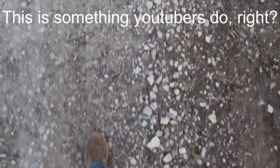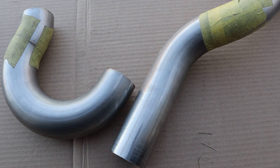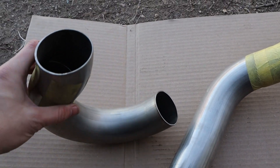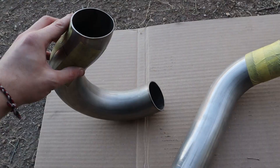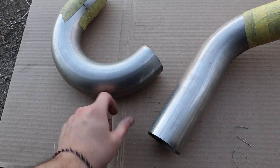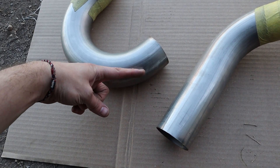I got some people to come help me turn the wheels. I basically ended up jacking the front end up and turning it to full lock just to check that arm clearance. We're actually good - the tubing is not going to hit that arm at all. We clear the driveshaft through there just fine as well. It sits about like that right now, kind of coming back up at the bottom, which is pretty good - that way it has a low spot here for our drain, and it'll keep everything up above the control arms underneath there.